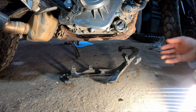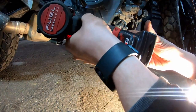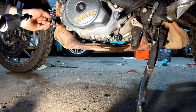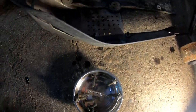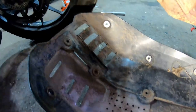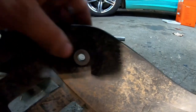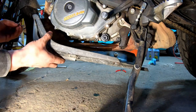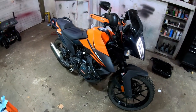Turn the bike back off and we'll go back to putting the skid plate on — just doing everything in reverse order. One thing to note on the screws: there are four of them that are longer. The four longer ones go through the holes that have the bushings in them — this one, that one, that one, and this one up here. The others just have a metal bushing, while these have a rubber one as well. And that's it! The oil is freshly changed and she's ready for another ride. Thanks for watching, everyone — see you later.